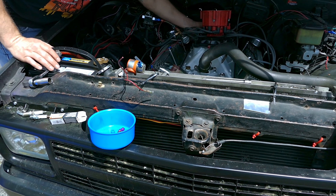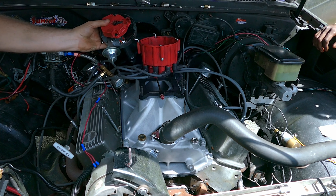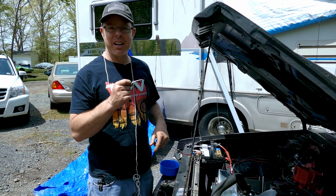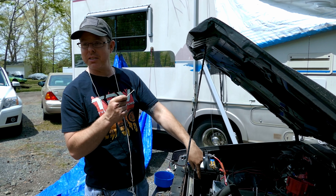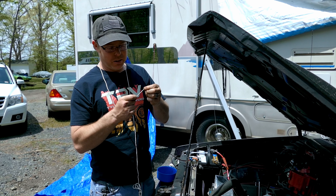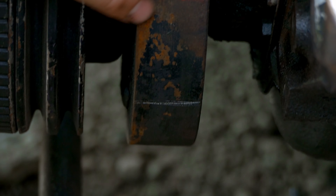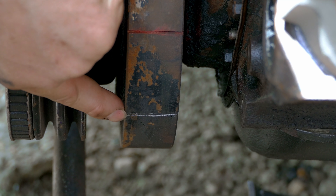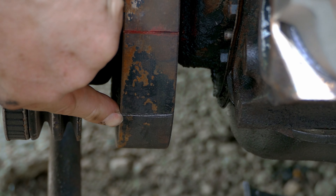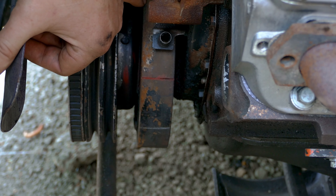Now we got to figure out where top dead center is on this guy and go from there. The next issue is after I found top dead center, I noticed that this balancer has zero timing marks. So we look around the yard, find a balancer that's the closest size that has marks on it. We take a string and say that's going to be roughly where 36 degrees is going to be. We mark the balancer. So now we have top dead center and some type of reference where 36 degrees is. That's very important because this distributor had the most unbelievably huge sweep of timing. So that's the next issue, but we'll get to that after we start it up.